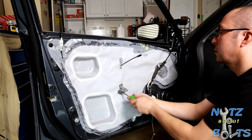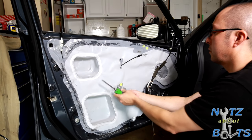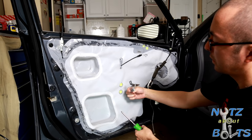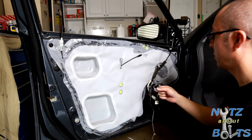This piece is in the way — it's a support piece of the door panel. Just make sure you take note of which way it goes back in, because you can also put it in upside down and not realize it.